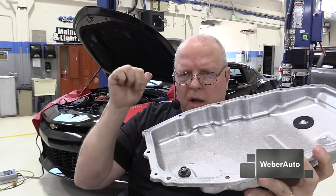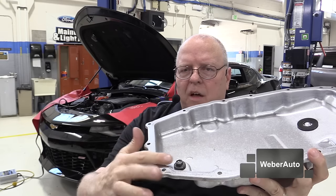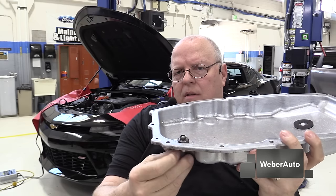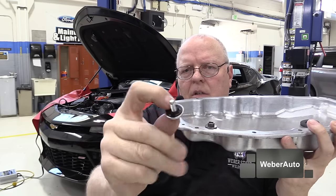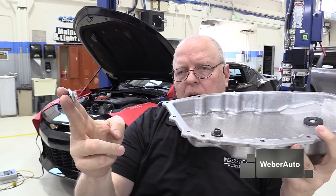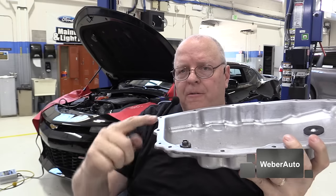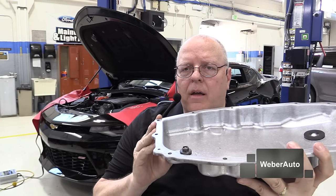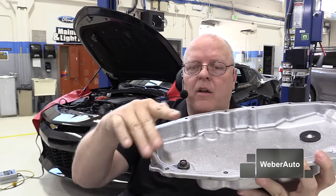So we're going to learn how to precondition the vehicle — it doesn't matter if it's a six speed, eight speed, or ten speed transmission without the dipstick on GM products. Then you're going to take out the transmission fluid level check plug. This plug has a little rubber seal on it and is only tightened to 80 inch pounds, not foot pounds. If fluid comes out after the vehicle's been preconditioned properly, then the fluid level was too high. If no fluid comes out, then you have the challenge of putting fluid back in until it does come out.